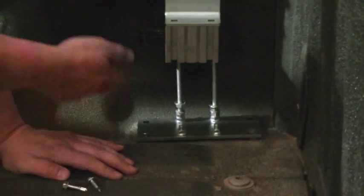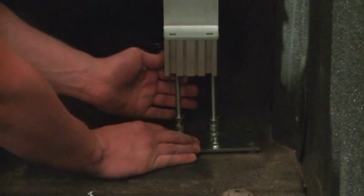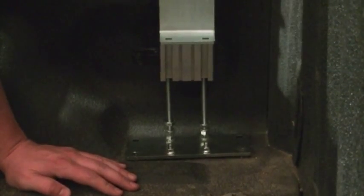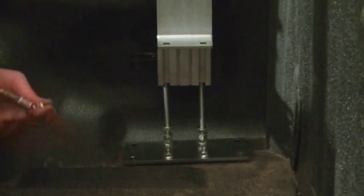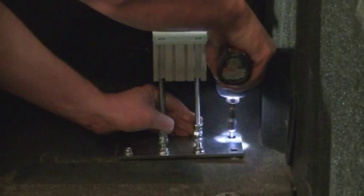We're now going to install the base plate of the leg underneath the leg assembly. We're just going to make sure that these two bolts are lined up with the channels of the leg material by sliding it over until we're satisfied. Once you have it in the right position underneath and the leg is relatively plumb underneath the rail itself, we can attach the base plate to the floor of the truck bed by using these two self-tapping screws. Now, instead of securing it totally right off the bat, we'll insert the tech screw, get it close to where we want it to go, recheck the base plate to make sure it's in alignment, and then we'll send the other one into the box as well.